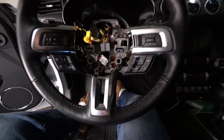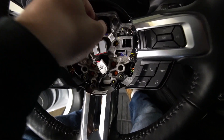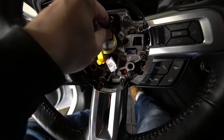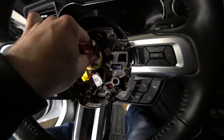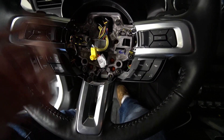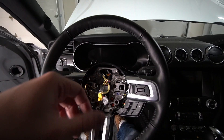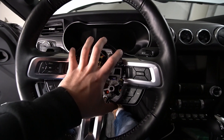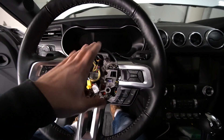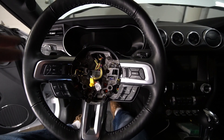I actually missed two clips — there was one right down in there, and the main harness one at the top. Now we take off the bolt. The way the wires were kinked up it was hard to tell, but I noticed it and double-checked, following all the wires. I don't think I'm missing anything else. Now it's just time to remove the wheel — it has to come straight back, you might have to wiggle it just a smidge. You just unbolt it, pull it straight back, swap everything over, and slide the new one right back in. 99.9% of the time you will not need an alignment if you do this correctly, so just be careful and take your time.